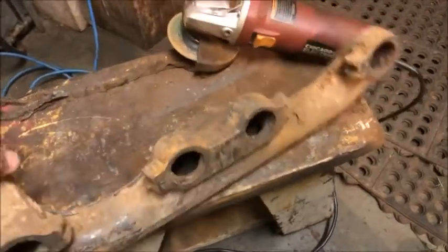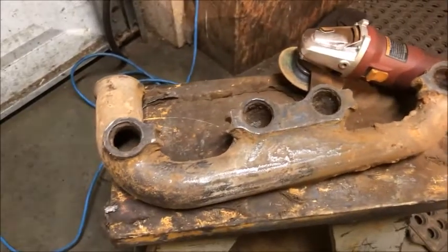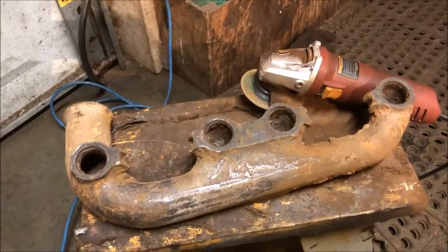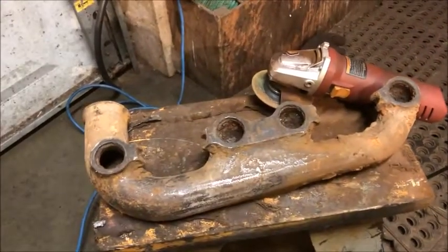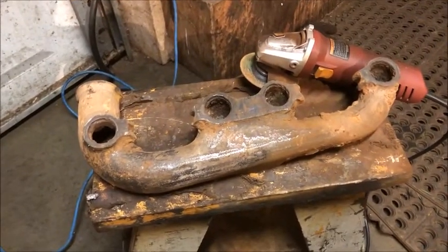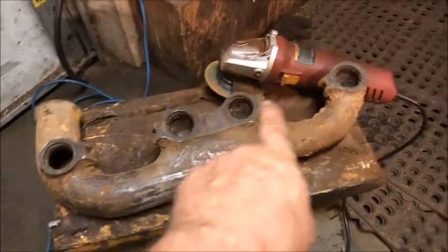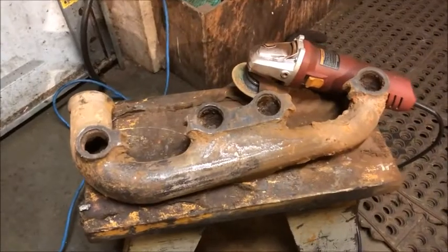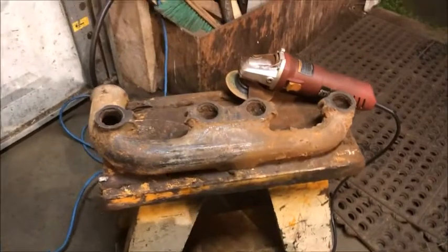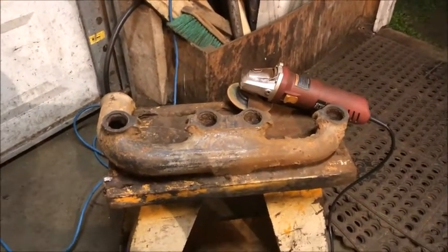The backside — when I get it all finished up, I have a surface plate that I use for surfacing heads with sandpaper glued on it. I'll just put that on there and stroke it back and forth probably about 50 times, and that'll help to clean up the surfaces. Should be pretty good. I'll send you another update when I get her done and get a coat of black high temperature paint on it. See you later, thanks for watching.